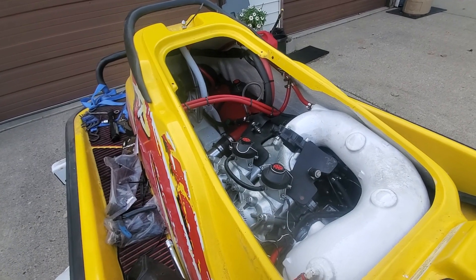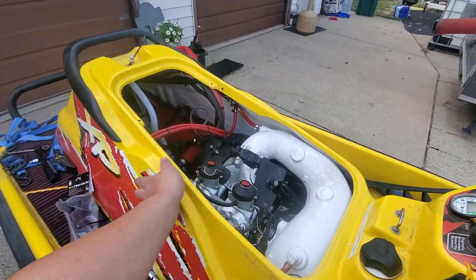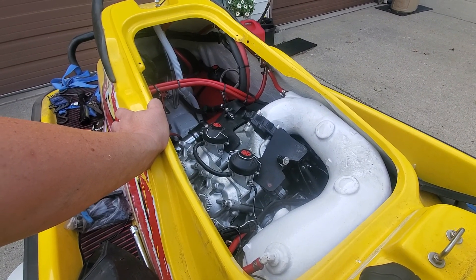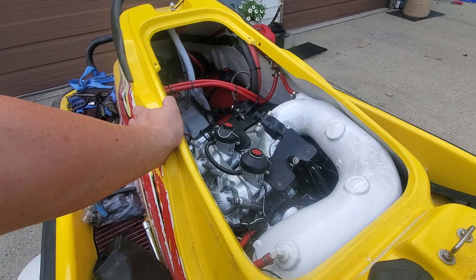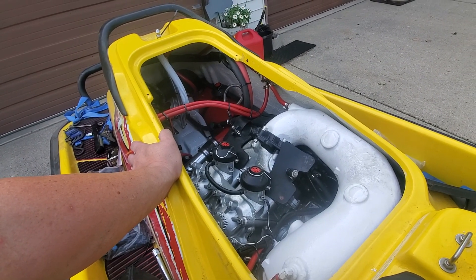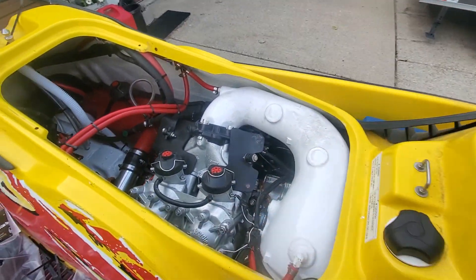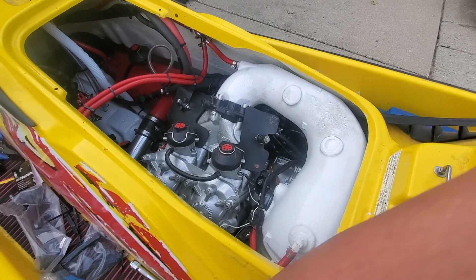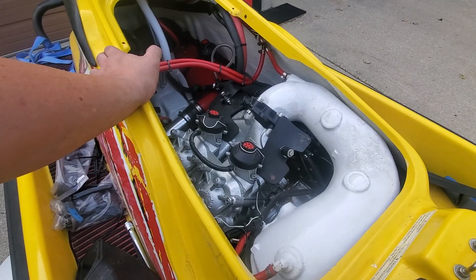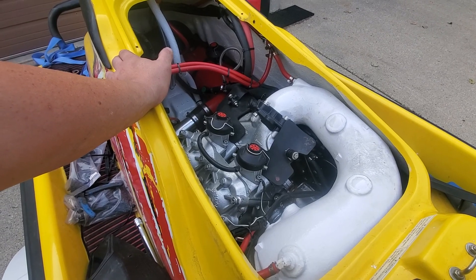Once we got the engine out and split it, we found the issue. Peter stood behind his work and got me a new counterbalance shaft — the other one was worn and was letting oil through, and it was damaged from all the shaking. My buddy Josh got that installed and timed the engine right — 180 degrees off from the mark — and as we can see, it's just perfect. It's not shaking to beat hell like it was before, and I'm hoping this is good to go.